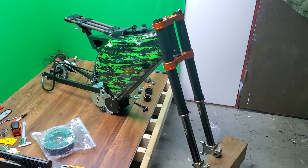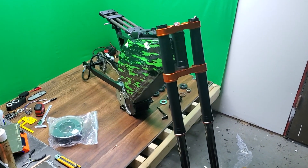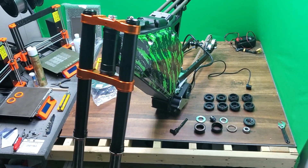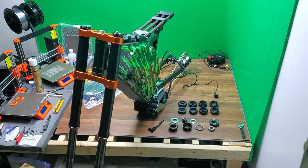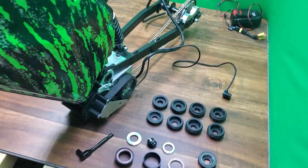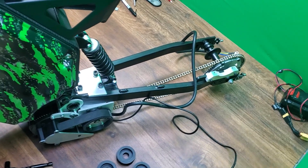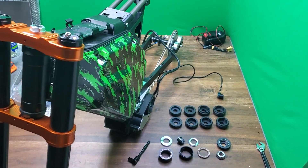This video explains how I attached a motorcycle front end to the Vector Typhoon or E-League Enduro frame, which is usually set up with downhill bike suspension systems. A quick recap for people new to the channel: this is a multi-purpose light electric motorcycle being built with the Lightning Rods big block motor. It's a 10kW rated IPM motor more commonly found in light electric trucks, so it has the grunt to shift heavy cargo. That same power will also make a light electric motorcycle with great torque and power.